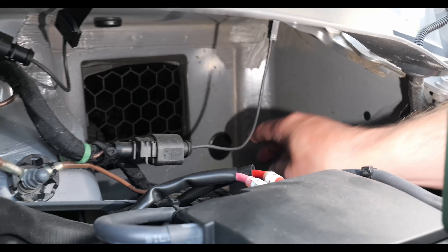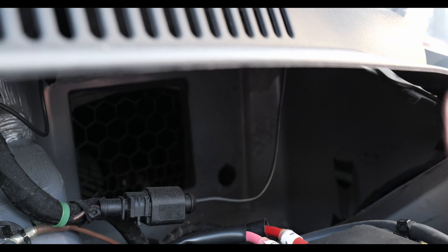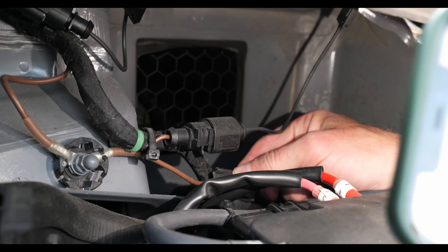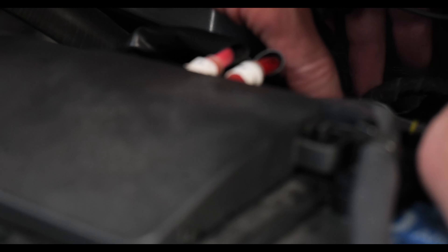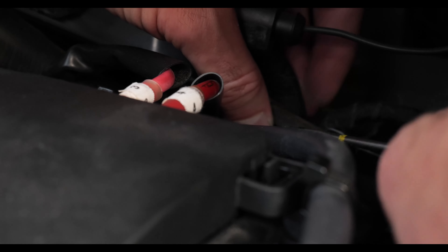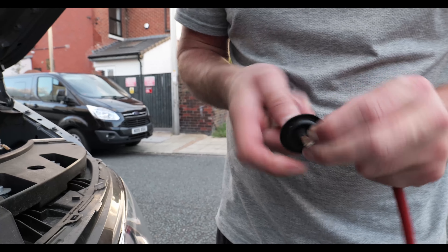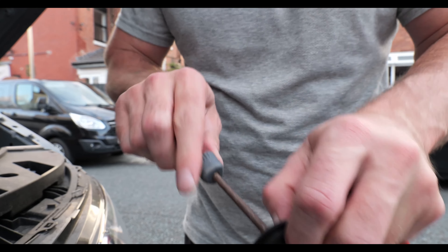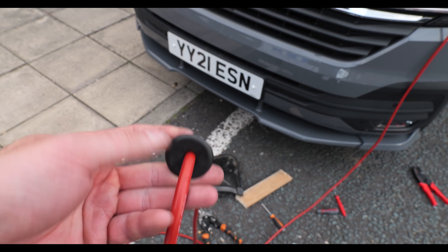What you're looking for — if you can see it back there — there's a grommet hole. Take that out, that's where we're going to go through. We're going to take this grommet out. There's another grommet just behind there; it sits in like a little sleeve, like a little metal frame. Use something like this — be really careful when you're pushing through that you don't hit any of these wires. You want to put a hole through here. All you want to do is put a little hole in it; you could heat that open to get a neater hole, but that's fine.